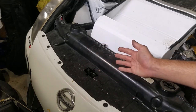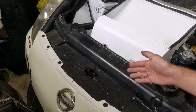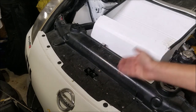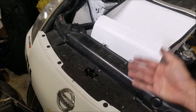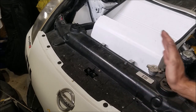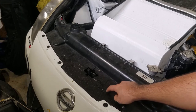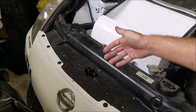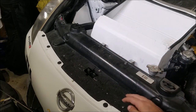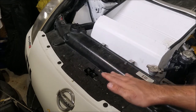You can use any thin piece of aluminum, steel, or even carbon fiber sheet. You will have to make some sort of template to test fit this back and forth, and I think the best thing for that is something like a cereal box — it's thin cardboard, easy to cut, and easy to work with. If I was going to make one out of carbon fiber, I would also make one out of metal first to use as a template, because cardboard will move out of the way of the hood pretty easily while metal won't. You really want to make sure it's perfect before you start cutting up your carbon.